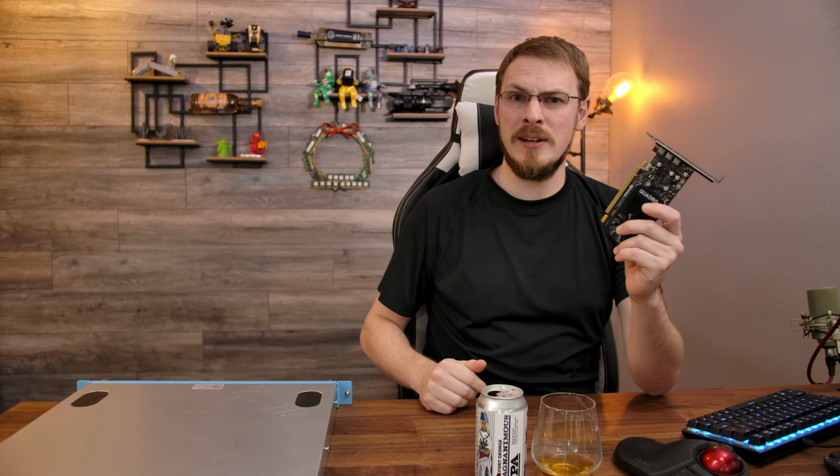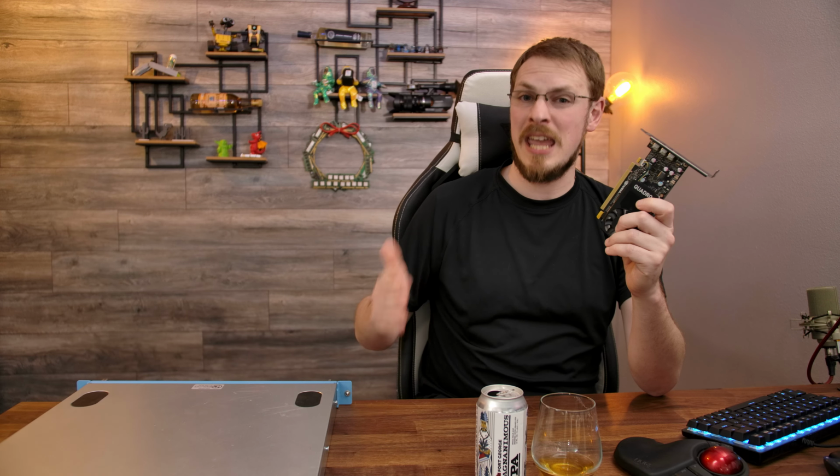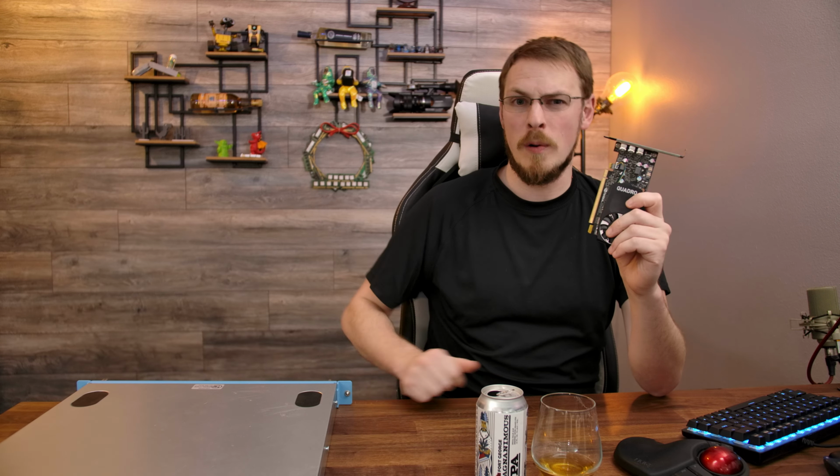And if you're not sure which model to choose from, I will have a full list down in the video description. Essentially, if your CPU does not have a hardware video encoder on board, it is just brute forcing the codec down to a more reasonable bitrate. However, having dedicated hardware, like an NVIDIA card or Intel's transcode built into Kaby Lake or higher CPUs, you can do it much more efficiently and at much lower power demand.